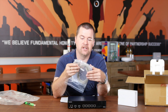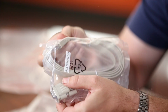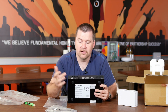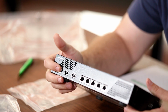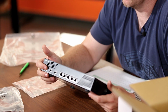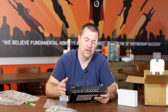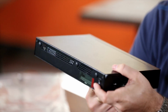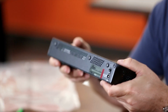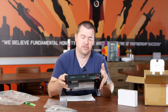As with other vendors, this is the serial cable, which is a legacy kind of thing in 2018, but still everybody uses the old faithful serial connector to a serial console. So you connect that to the console port. Please do not connect network to the console port, just use the serial cable, and then use 9600 BPS, 8 bits, non-parity, 1 stop bit in the terminal, and you can interact with the box itself for initial configuration. Since this is a small firewall, it just has one power supply connector, so you cannot really use redundant power supply. If the power supply dies, you have to switch it. But then again, this is a really small box.